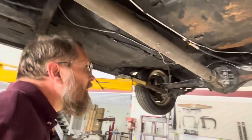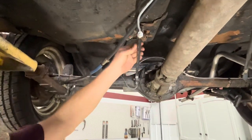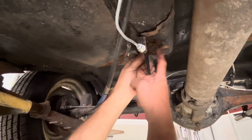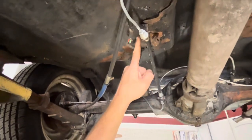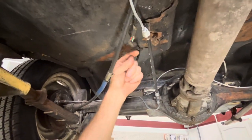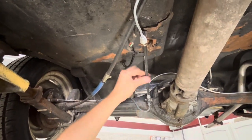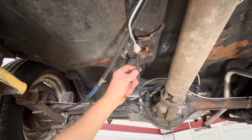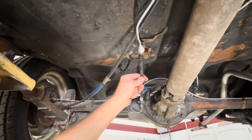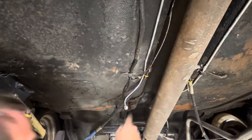Moving on further back, I do not like this at all. Rather than cutting this out of the bracket, they just put a new bracket on, but in this case instead of putting the bracket right up here they stuck it way further forward, putting this in constant tension, which is not a good thing. Maybe sitting on the ground there's less tension on it — I'll have to look at it once I get it back down. But I'd like to see that changed, and to change it you've got to put a longer piece of brake line on, or find some excess brake line and pull it back this way to get it further back.